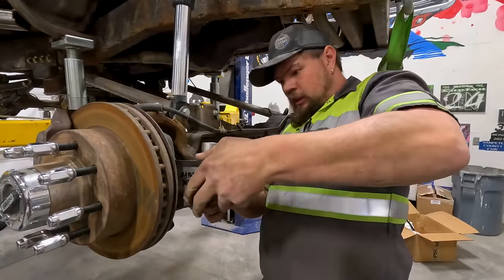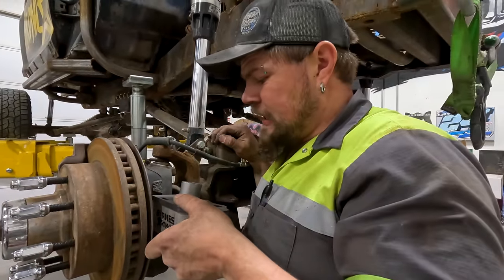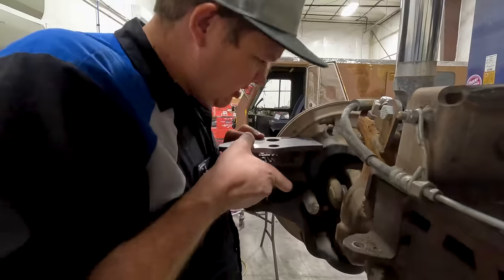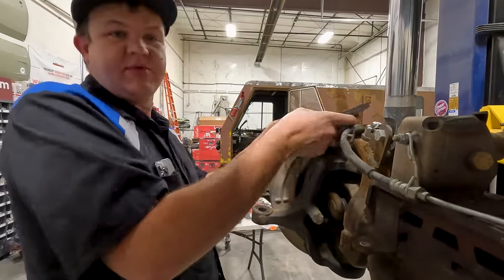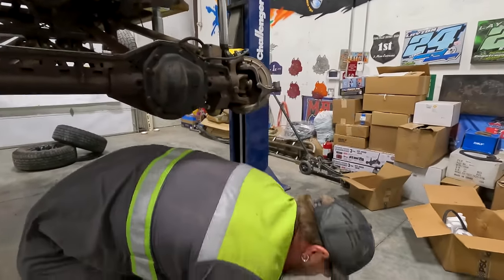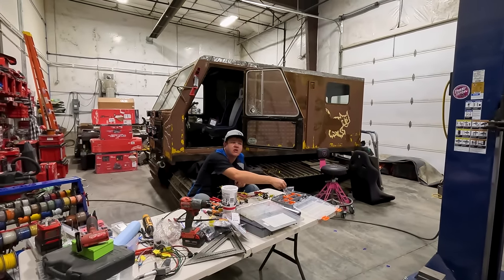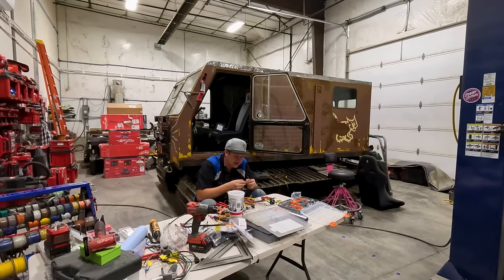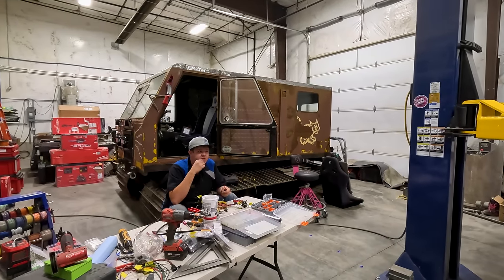While Robbie's doing the wiring, I'm trying to figure out exactly how this high steer kit goes on. We're going to have to modify it quite a bit because it's built for a Dana 60 and this is a Dana 50. Hillbilly did some research and realized a Dana 60 knuckle will go on this Dana 50. I just so happen to have a Dana 60 sitting out back. So tomorrow morning Hillbilly's going to strip some knuckles off, put some Dana 60s on — and tonight he's going to get those knuckles off and start getting everything in place to where we can get the power assist ram on.